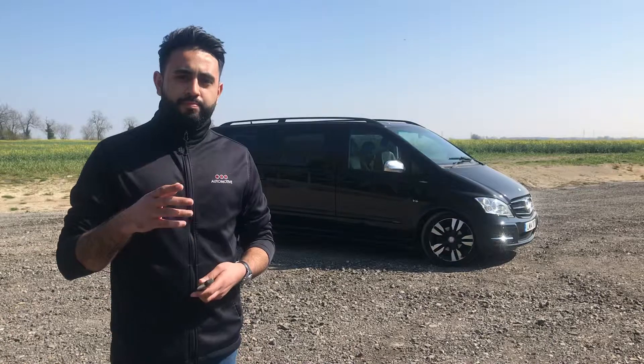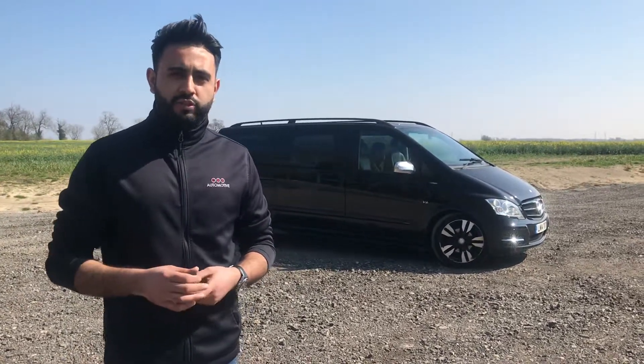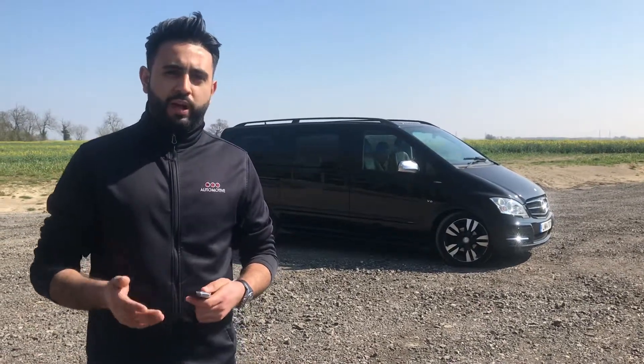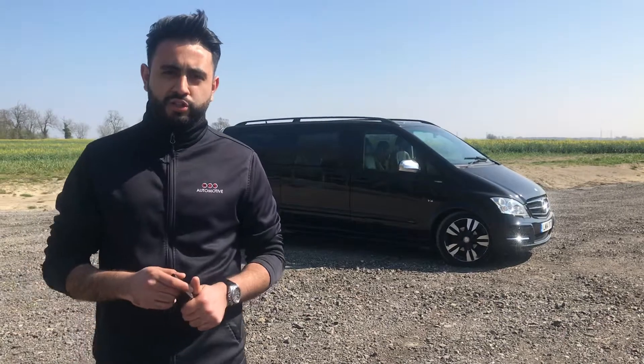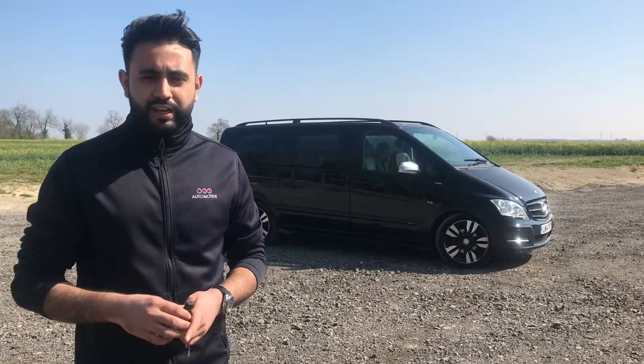In terms of the parking sensors, it's a very common solution that we do. They've all been painted as well — the vehicle's black, so we've added a gloss finish to them, so they look really factory. I'd probably say they actually look better than the factory system. On the reversing sensors, because of the size of the vehicle, we've moved the buzzer forward in the vehicle, and we do this on practically every large vehicle we add rear sensors to. It just makes the volume a little bit louder so you can hear it easier. A phenomenal system.